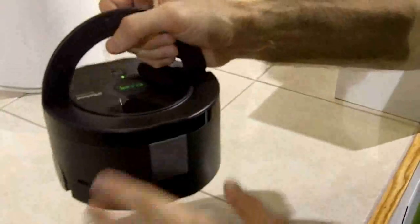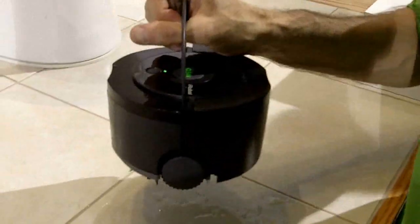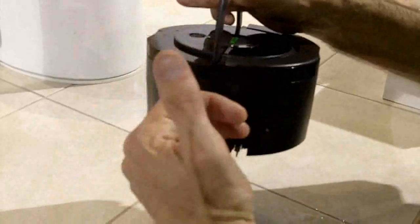I don't think I've closed this door fully — I left it open, that's the problem, it's dripping. As the clean solution is put down, the dirty solution is picked up by the squeegee in the back. That dirty solution goes into the same volume where the clean solution is, but they never mix — unlike a mop that goes in a bucket — because the active reservoir full of clean solution shrinks as it's put down on the floor, leaving room for the dirty solution to come in.